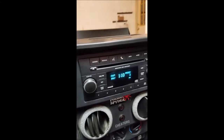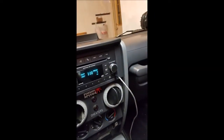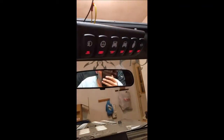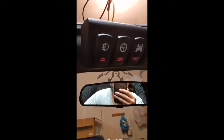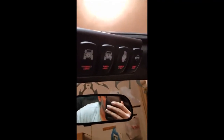Once you start the Jeep up again, my accessories are on right now and my sub is running — no problem. You're not going to have any LEDs on like this when they shouldn't be. If you just want to swap your switches over to red LEDs, then if you have red LEDs on all the time it's not going to bother you — the blue ones bother me. Now that our switches are on a dimmable source, all of our lower LEDs on the Rough Country switch pod are independent. Those come on with our dash lights, and now they're also dimmable. This is the most dim setting — the most resistance — and then those are brighter.